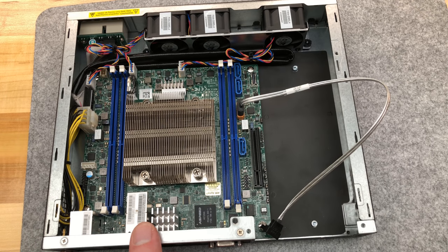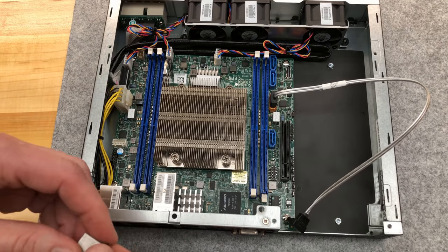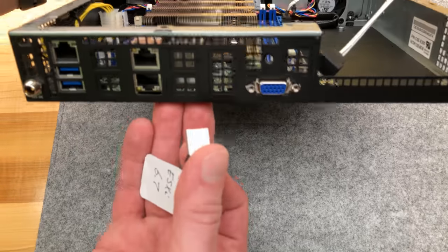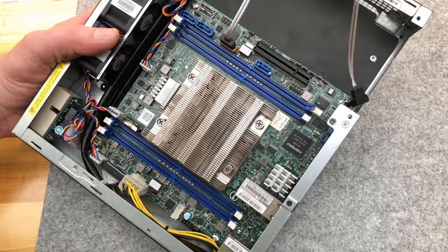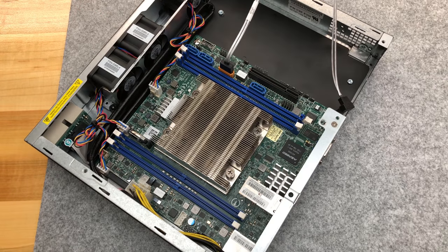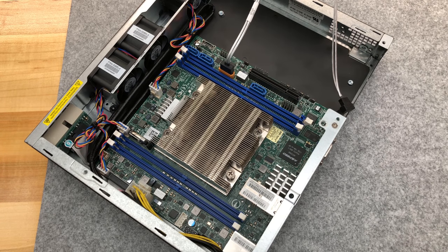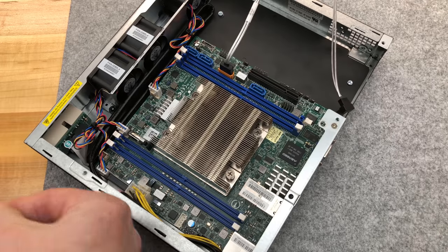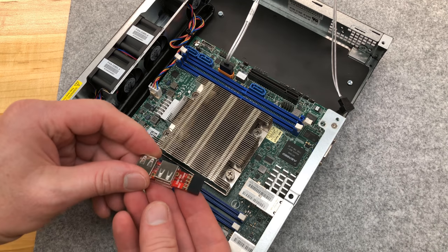Now to install ESXi — I don't have a lot of time if I'm doing one-cut rolling, so I might want to take an ESXi 6.7 I already have installed on a USB key; that'll shave quite a bit of time. Where am I going to put that? It's my boot media — just booting into RAM, the speed of USB 2 or 3 doesn't really matter, I found boot time is the same. Does the motherboard have a USB header? The answer is yes, right there.